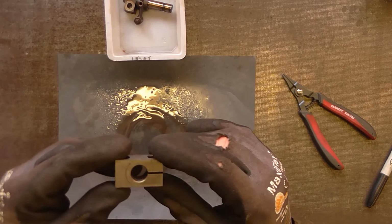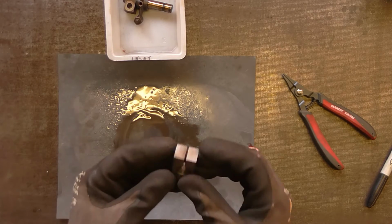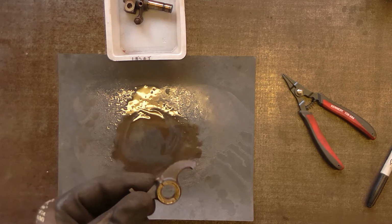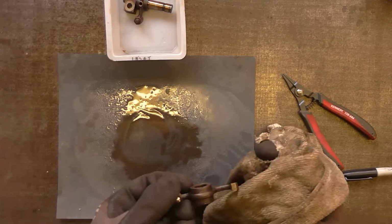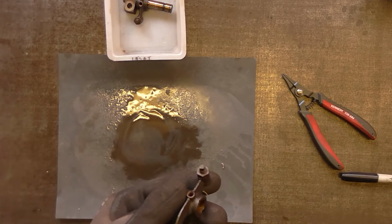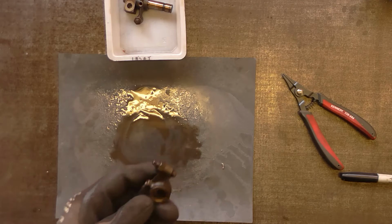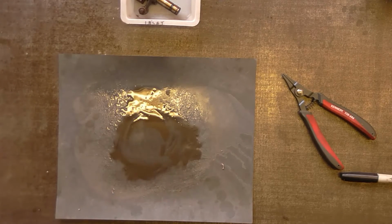I mean, the finish here looks to be from the rolled stock. That'll do just fine. And this is of course the split block that actually clamps the rocker shaft. Now, as far as the rocker is concerned, there's virtually no surface rust, so just to wipe down, I'll perhaps give the adjuster screw a quick brush with a brass brush, and that'll all be good to put back together. I'll do the same on the inlet assembly and of course on the other cylinder, and that's all good to go back on.